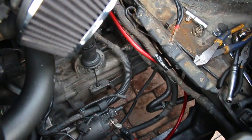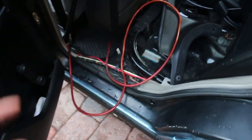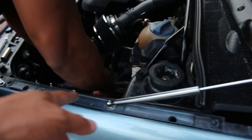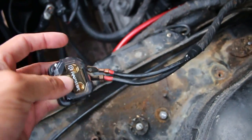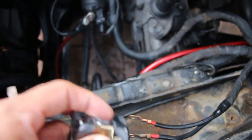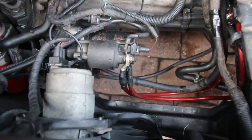I'm going to pull the wire through the car and get it all tucked underneath. Now we have our power cable going up to the starter, running through the firewall, going through this side, and then into the trunk to the battery. We'll use our power distributor up here — we have two wires, one to go on each side, both into the distributor, and then one wire coming out going to the starter, which will give power to everything.